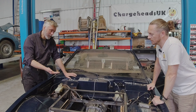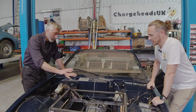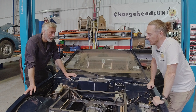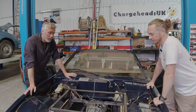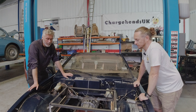We've got to get the cooling plates in — it's going to be liquid cooled — along with all the other wiring. On the outside, we're going to put stainless steel panels so that we can unbolt them to do any servicing. We could use aluminium, which would save a bit of weight, but to be honest the amount we're using is so small anyway, there's not much of a difference. The stainless has just got a much higher strength given the amount of space we've got.